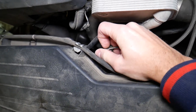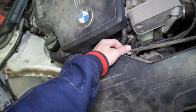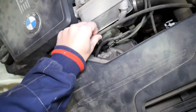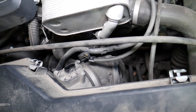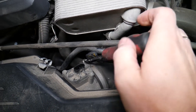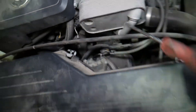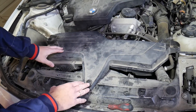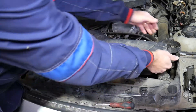Press in and pull it out — perfect. Now let me release that cable for the hood latch. Right here, we have one hose clamp that we need to get loose — this is for the intake hose. Pre-loosen that with a flathead screwdriver. That's the air filter box. It has three rubber bushings — one here, here, and here. Gently, without damaging anything.